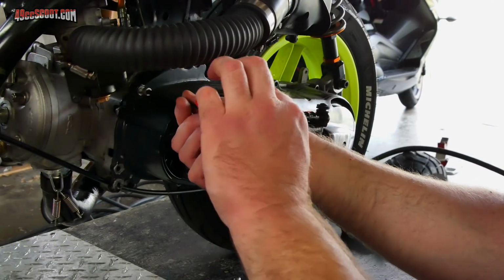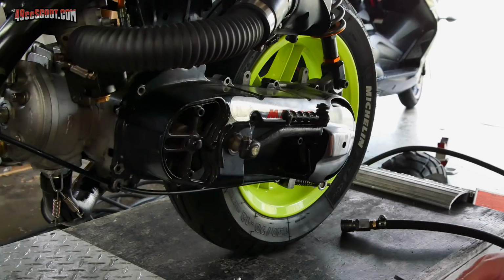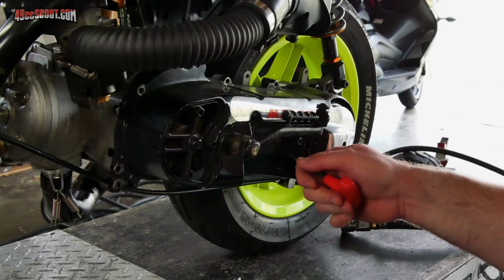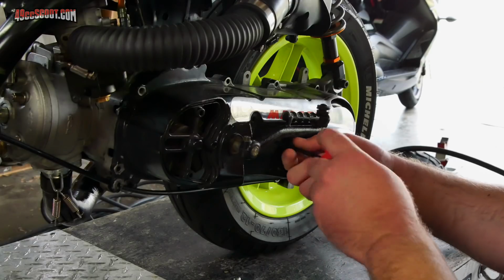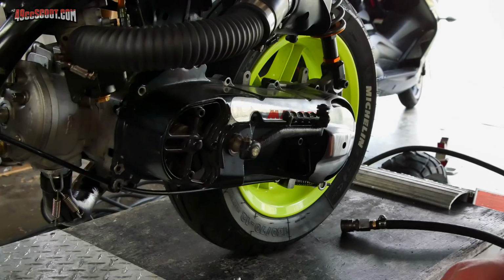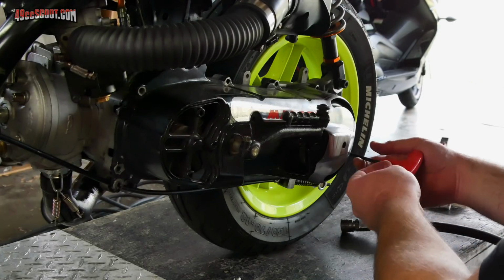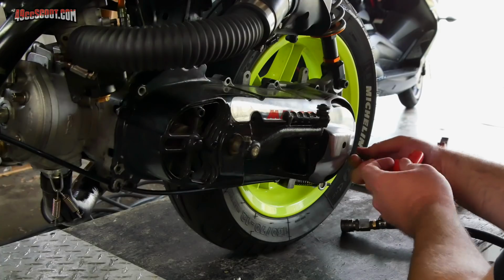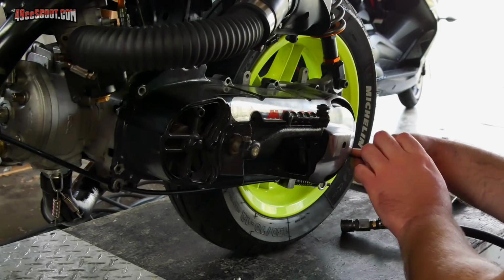That went much better with a 105 main jet. It felt a whole lot cleaner, and it actually would pull, and I could hold the throttle open without it feeling like it was bogging down after holding it for a few. So I could feel more power when I was taking off. It got up to, I think, about 62 miles per hour when I was just sitting up going down the road, probably with a little bit of a tailwind behind me.